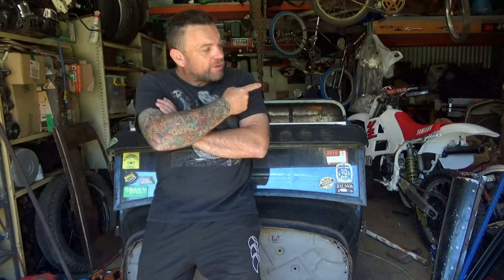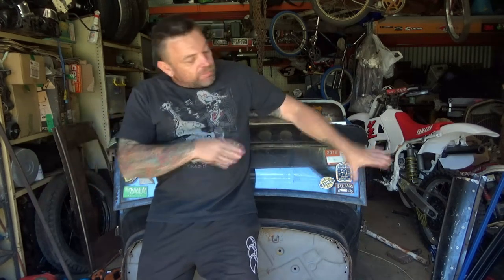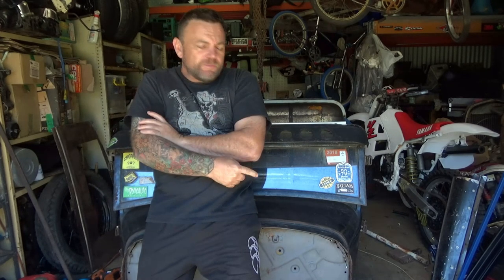So really I need to dismantle that car, so it's out of the way, make a bit more space in here for the chassis. As soon as I can, once I've measured all out, I need to cut the back of the chassis off, the bits that I don't need. But before I do that, let's take these doors off. We'll cut the welds, take the doors off, and we'll flip this thing on its side and finish welding off underneath. Let's do that, eh?